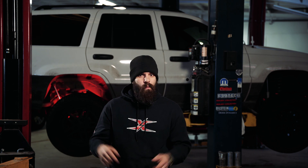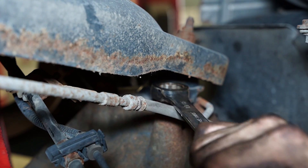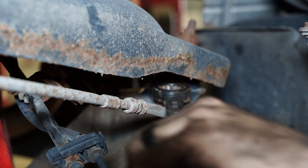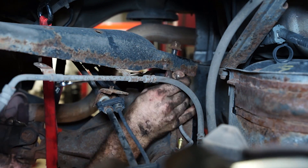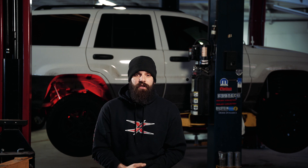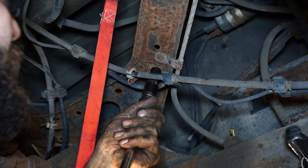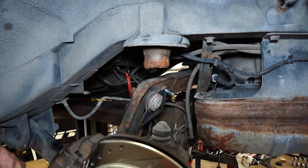Here comes the most difficult and frustrating part: removing the old Y-link stealth bomber thing from the back of the WJ. There are two bolts under this thing that go into the top of the differential — they suck to get out; they are Loctited in and it's going to take time. The only way I found was to use a 21 or 13/16 ratcheting wrench and just brute force these things out. You'll also need to disconnect all of your lines — brake lines, ABS lines, all that stuff that runs down it — it's a 13-millimeter. You pull all of those off and get the bolts off the differential, and this whole thing comes out as one piece.